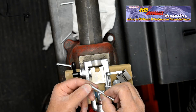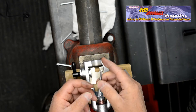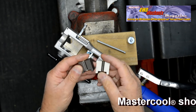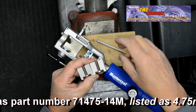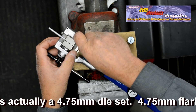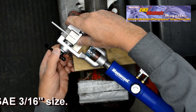It's worth noting that the quality of the tubing and the electro-zinc plating make a difference in terms of resistance to marring during the tube flaring process. This practice tubing is not the highest grade, although it is .028" wall thickness, and improved quality would reduce the likelihood of this kind of marring. Let's move to an ISO bubble flare — this is where the Mastercool Hydroflare tool excels. The die set for the ISO 4.75mm size is optimal for a DIN-style ISO bubble flare.